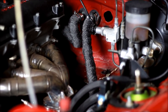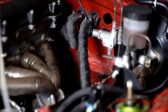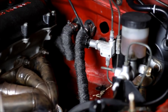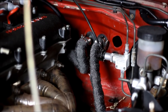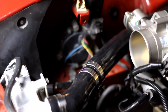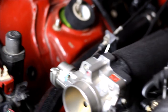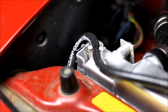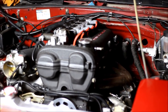Fast forward a couple days — now the cooling system is hooked up 100%. On the left side back there is a factory heater core hose, and then the right side is the silicone one you saw earlier. That wrap is actually header wrap and I'm using it to protect the hose from the heat of the exhaust manifold, so those should be good to go. Over on this side there's my 45-degree elbow which kicks that long hose away from the manifold, clears the throttle body and throttle cable, and then it goes back there. I've got my overflow tank all hooked up and the hose just wraps around and goes right underneath — super stealth. This thing's actually starting to look a lot more complete and we're getting close. We're gonna be firing this thing in no time.